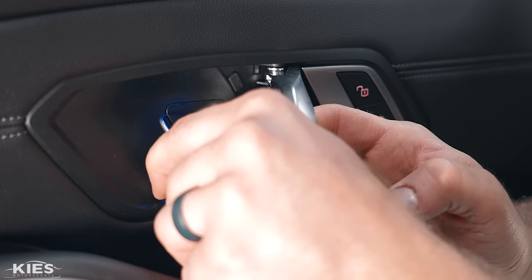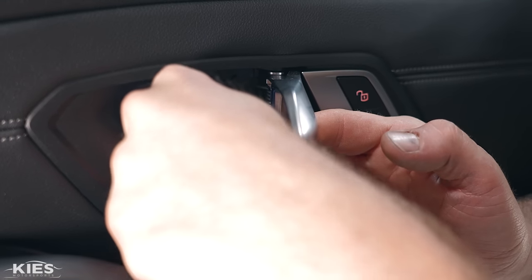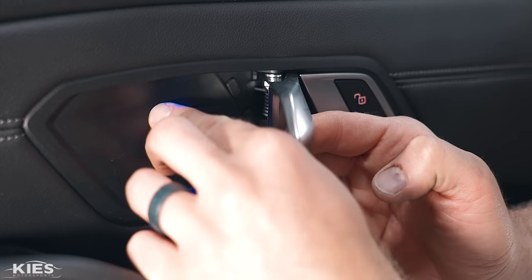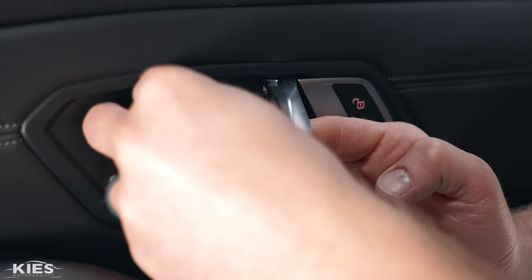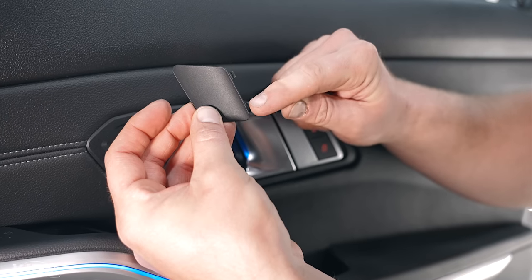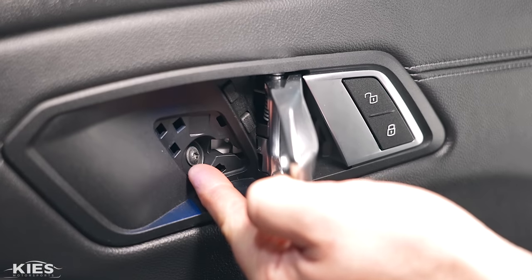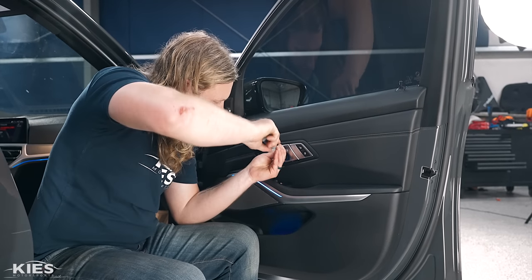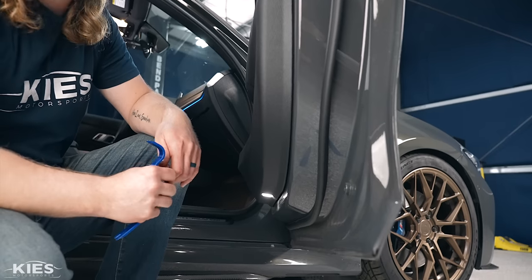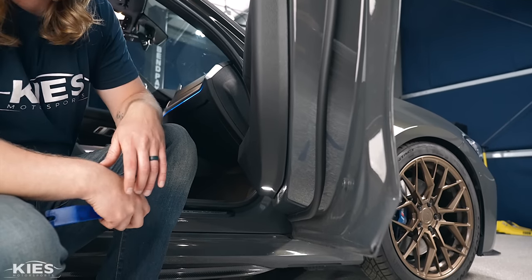You're going to need to pull the handle and remove this little piece of plastic trim — there's a clip over here, a clip over there, and then it snaps in. It's always a good idea to remove this corner first and work your way down. It's so tight it'll be really hard to get a trim tool in there, so carefully — keyword is carefully — take a pick tool to pop it out, then continue popping it out.